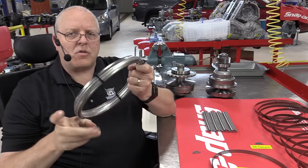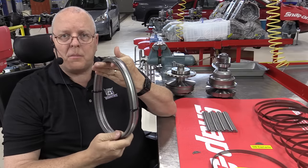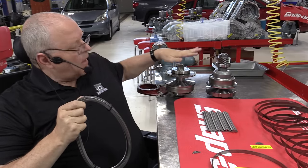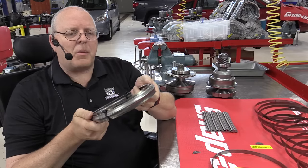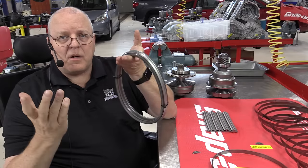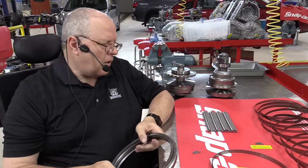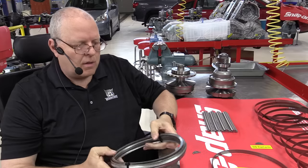Hello, my name is John Kelly and this is the Weber Auto YouTube channel. Today we are going to look at the construction of a CVT — continuously variable transmission push belt — the belt that goes between the two pulleys on a continuously variable transmission. I get a lot of questions from students and others asking how a belt made out of steel can be flexible and hold up. I've got a belt that is all taken apart right here on this bench and we will put it together to make a full belt today.